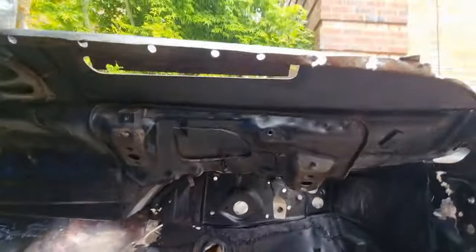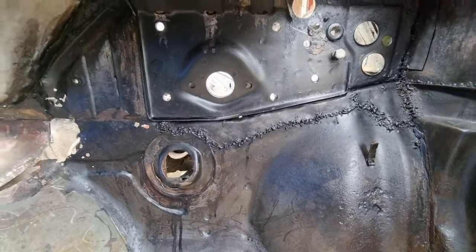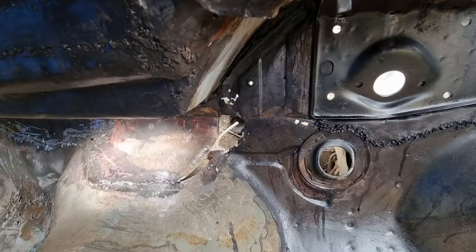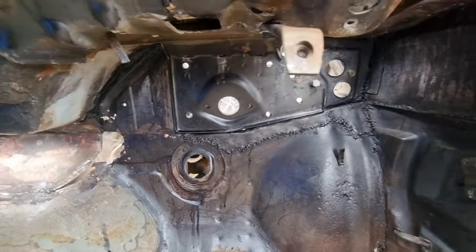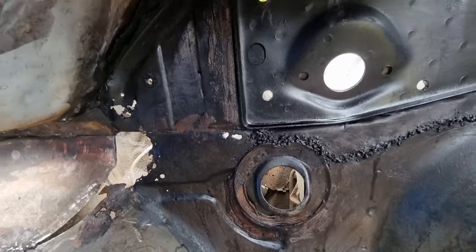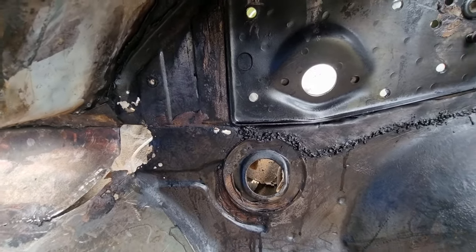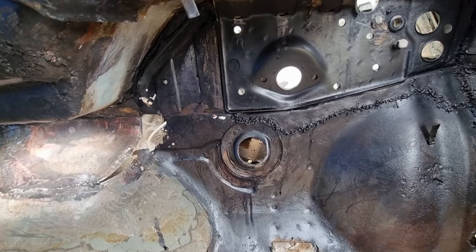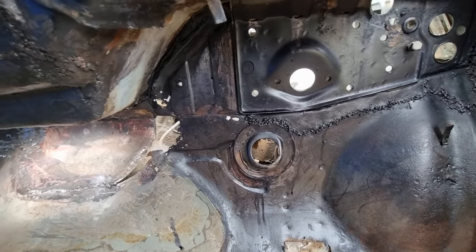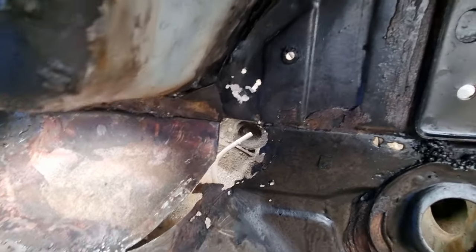That's what I did last time I was working in here. I just have to grind them down a bit. I'm now going into that corner. But look how good all that looks. That's the parts that'll be kept, all up there's repaired around the steering column area. I had to bend that back, put the new metal in and bend it back over again. I've just got that bit, that hole up there to fix, a couple of little pinholes there.